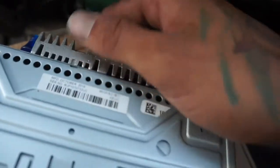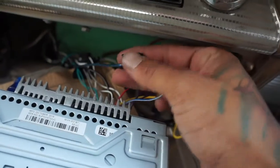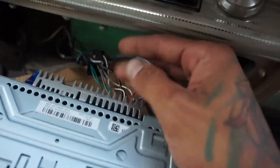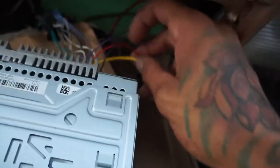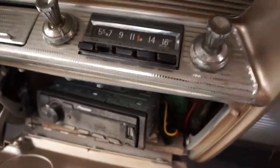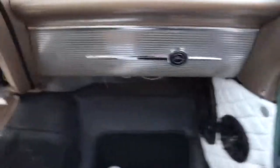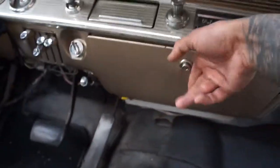It shuts off when I shut off my car. All the other wire colors go to speakers depending on how many you have. There's also a wire in the back that goes to my amplifier for the subs, and the blue wire goes to the amplifier to turn it on. So these are what turn on the radio in a hot rod, and that's how to do it. I thought I'd need some adapter or something, but nope — it's pretty easy. I tried to find a video showing how to do it and couldn't, so this is how I did mine.